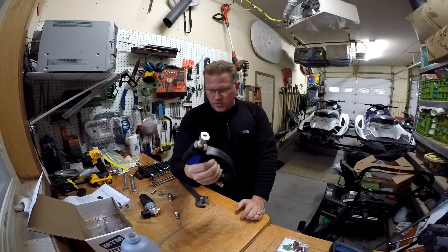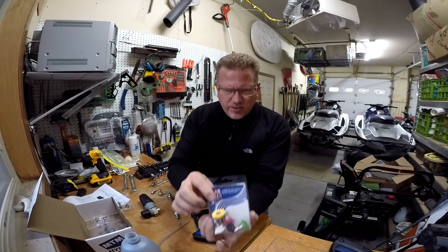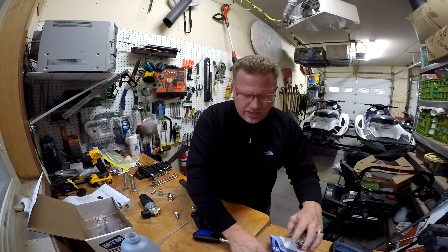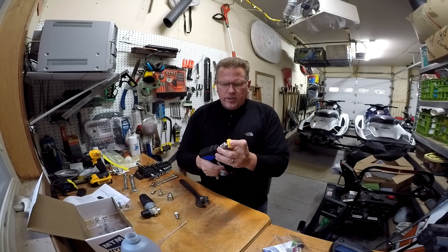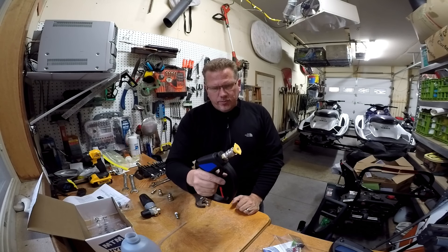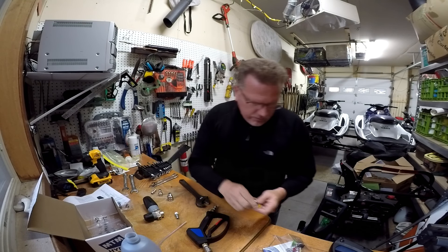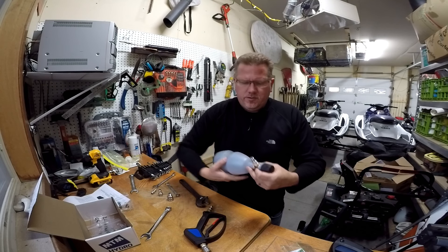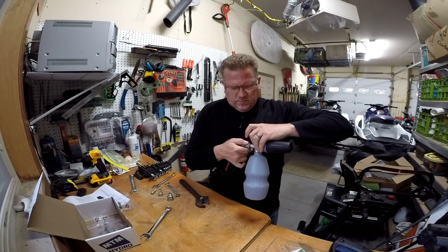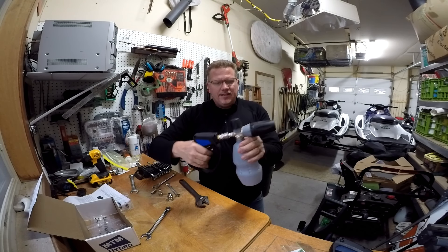The gun is assembled and ready to go — it's good to connect up to our pressure washer. The tips come in different sizes and they're color-coded — these are international color codings. We grab any one of these tips and they'll snap into the end of the gun even if we don't have a wand. We pull down the collar and snap it in. Now we've got a pressure washer gun pretty much as it sits. The next goal is to get our foam cannon hooked up to it — we put it in the bottle, move straight forward, and that attaches to our gun. Foam cannon on gun — there it is, ready to go.